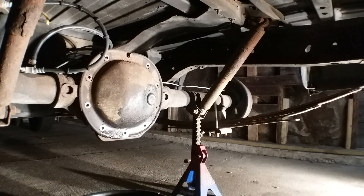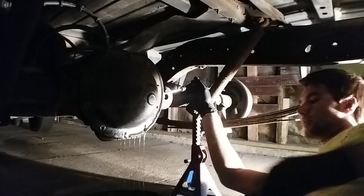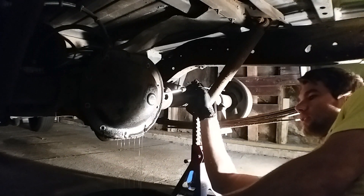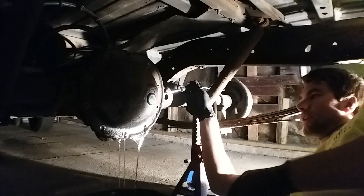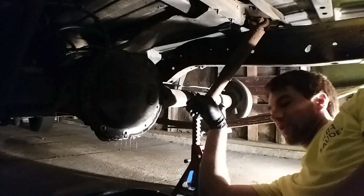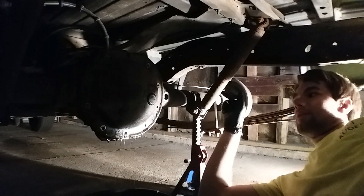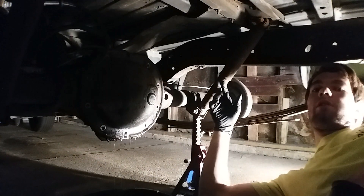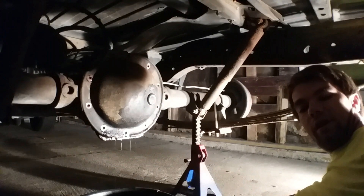It's the middle of the night, by the way. I can smell that diff fluid — that stuff stinks so bad. It doesn't smell burnt, it just smells terrible. I'm going to take all the bolts off until there's just the one on the very top, loosen that one a little bit, and crack the diff cover forward so it'll be a controlled pour. Okay, do not want to pull that bolt all the way out — need a screwdriver. There she blows. It looks really clean still. I'll just let it drip for a little while and then take the cover completely off.